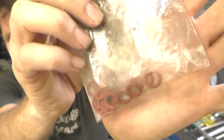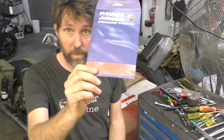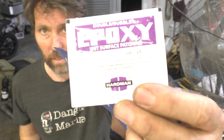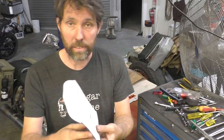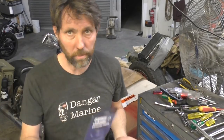This is just a little packet of fibre washers to put onto the drain plugs and fill plugs of the gearbox — some outboards have O-rings, some have fibre washers. This is a really good thing to have regardless of the brand: if you've had trouble with the magnets under the flywheel, it's basically an epoxy for attaching the magnets to the inside of the flywheel. I had an outboard recently where one came off, so I bought this kit. It came with a couple of sachets — I used one sachet to fix that outboard and I'll keep this for next time.